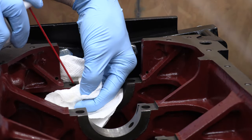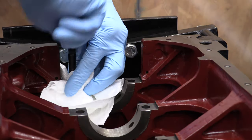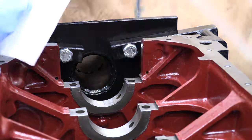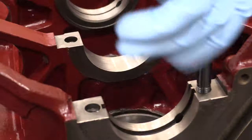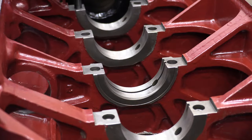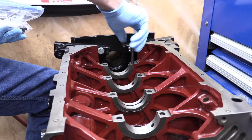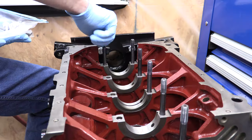Since you're not supposed to lubricate the inner threads of the engine block when you use studs, perhaps this cleaning method would help those mechanics who are insistent about installing head studs one at a time while the head's still on the block. The solvent might damage gaskets, sure, but it's a lot better than blowing head gaskets because the studs keep backing out.